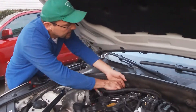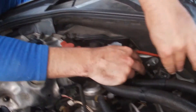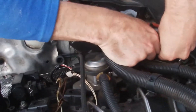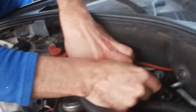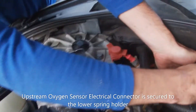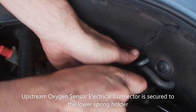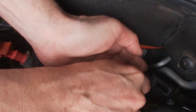Now it's time to connect the electrical connection. I routed the wire from the oxygen sensor back up. Now I'll make the electrical connection — a nice snap. This one goes on the lower spring, and the downstream oxygen sensor goes on the upper spring.